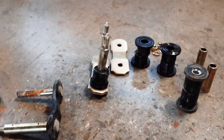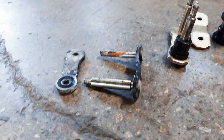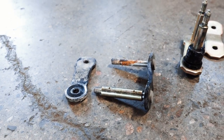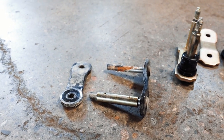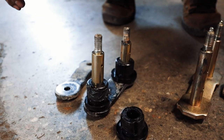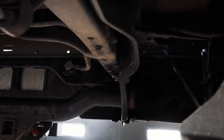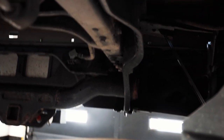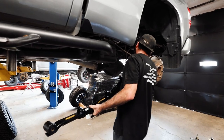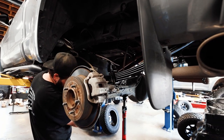One issue we ran into is that the bushings for the new shackles don't fit like they're supposed to, but if you put the sleeve on the old shackle bolts and then the bushing on there, it fits like it's supposed to. So we're going to use the factory shackle with the sleeves and put the bushings on those — fits much better. With the OEM shackles going back in, you'll have two sets of bushings: the longer bushing goes on the back and outside of the shackle, and the shorter bushings go on the front of the leaf.